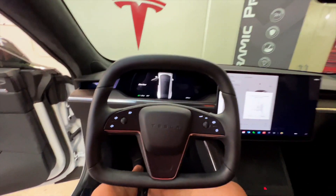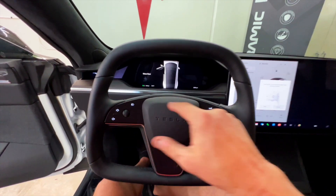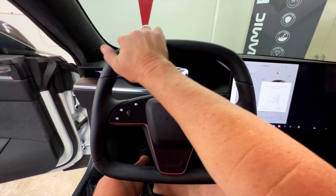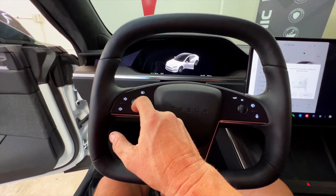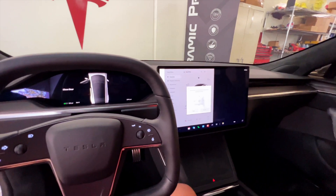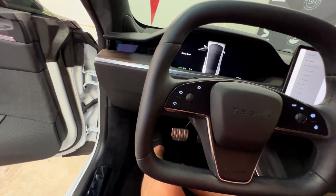Now talking about perspective and angle: your seat can help you decide where to put the steering wheel. If you're shorter, you might want it like this; if you're taller, you'll want to roll it up. Gauge visibility is what we're very proudest about — look at the entire gauge cluster, you can see everything through our D-shaped wheel. We want people to have the feel of a round steering wheel and the visibility of the gauges and maps. Select it high or low depending on your seat height. Make sure you can see your gauges. That's pretty much it — done. You'll put the old wheel back in the box, we pay the shipping back. Two clips, two Allen wrenches, and a bolt. You can keep the tools.